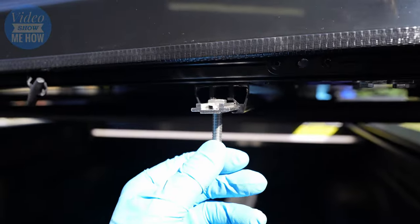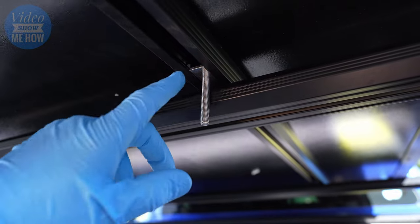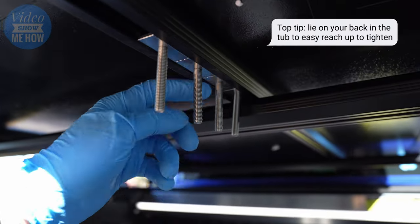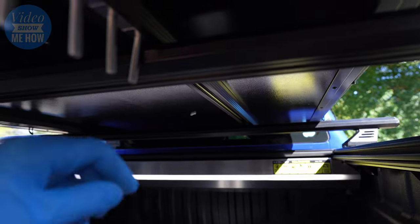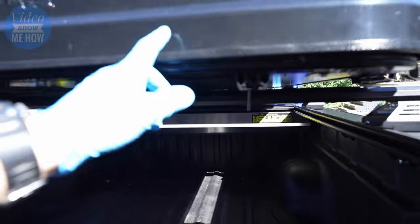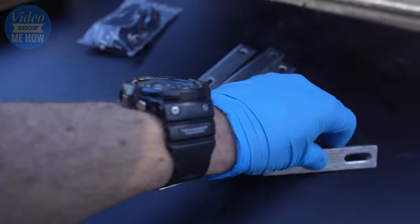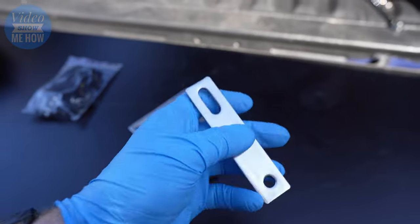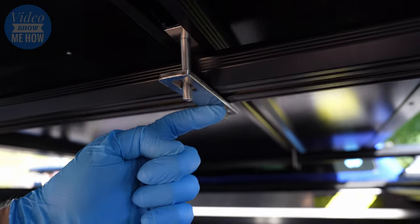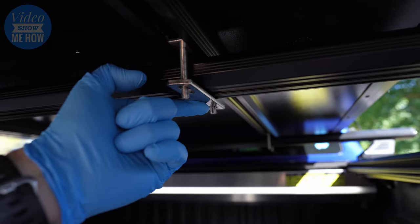Take the end caps off and the load spreader fits straight in. You want one on both sides of each rail. I recommend getting all four slotted in — two down each end — then do the same on the other side. Double check your measurements, make sure you're happy with the tent position, then grab the bracket plates. You can see one side has an adjuster slot. Slot them on loose to begin with, double check measurements for the final time, then we can get the nylock nuts on.